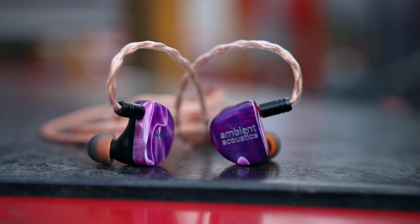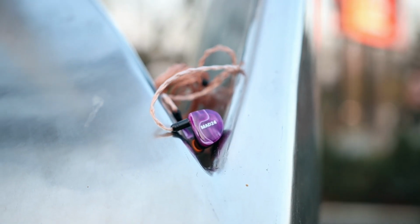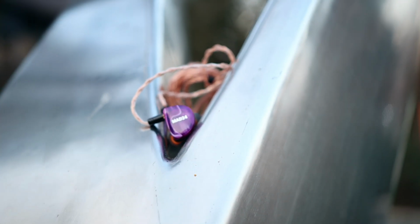There is a ton of headroom, which again isn't quite expected because usually when you have balanced armatures, you expect less headroom. So you would expect less EQ options and less overall headroom to go for. You would expect their performance to worsen slightly at the highest volumes. That tends to happen with most balanced armature based IEMs when there is no dynamic driver employed. Usually the overall quality tends to be slightly worse at the maximum volume and slightly better at medium high and quiet volumes. This is something that I've noticed with virtually all IEMs based on balanced armature drivers.